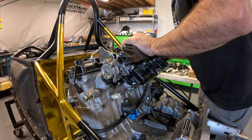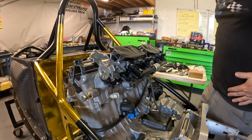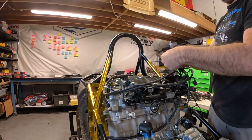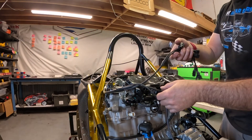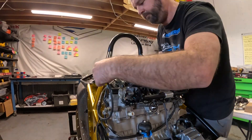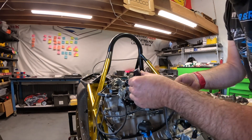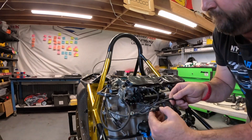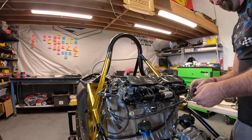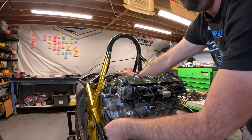To really test how everything fits, one of the most important things we've got to put on the car is the throttle bodies. Here we're just going to drape the ECU engine harness over the motor and start plugging everything in. Some stuff doesn't have a home yet - like the lambda wire or the O2 sensor wire up at the top - but we can start plugging in the coil packs, cam sensors, upper and lower fuel injectors, as well as coolant temperature, gear position, and we're going to try to do the crank trigger. We don't have a map sensor with this system at Franz's recommendation because he feels we can do the map and make sure that just with the TPS and RPM we can properly tune the car.